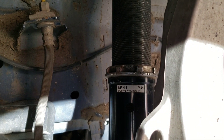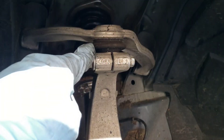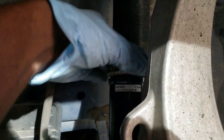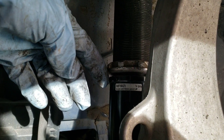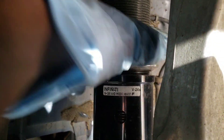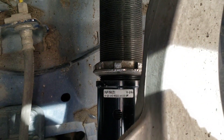Let me give it a shot — let me just loosen this first and we'll see what we can do. You can also take off this 14mm bolt and nut for better access. Now that I have the collar loose, you're going to use a measuring tape and start spinning this upward until you have about two inches between the bottom of the shock and the bottom of the collar itself.